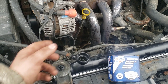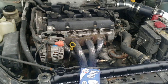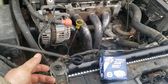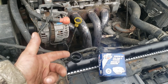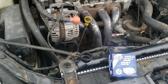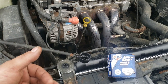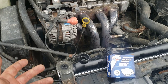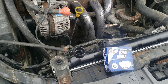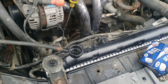Top it back off, see if there's any more bubbles. When it stops, top it back off. You need to go back and forth and check your temperature gauge the whole time. Make sure it's not overheating — if it's getting too hot, shut it off. Sometimes shutting the car off, letting it sit for 10 seconds, then starting it back up will push more bubbles out than with it continuously running. So you've just got to play with it until you see no more bubbles. It's been running for about 60 seconds now, so far nothing's happening. We'll wait until it starts getting warmed up and see what happens.